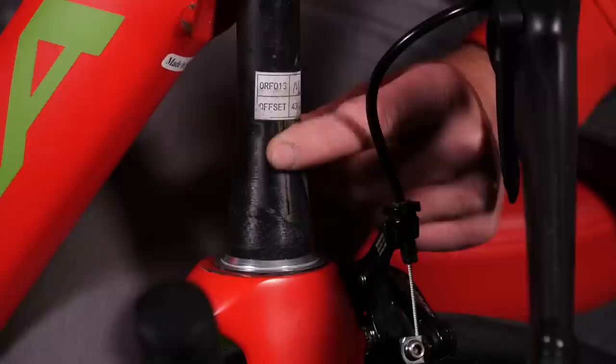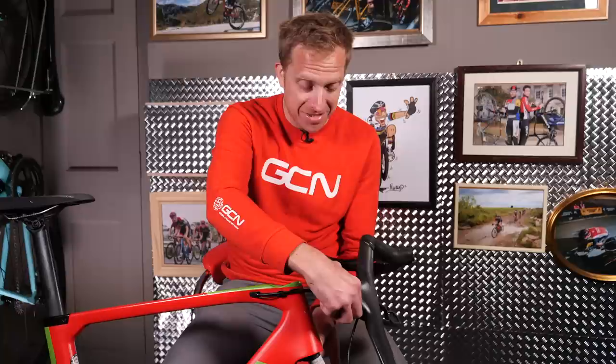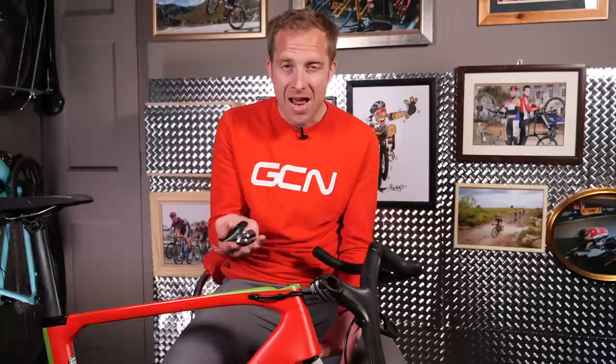The only downside, just like with the threaded style, is the fork crown race at the bottom on the fork crown. This is Chris Opie's bike — hope he doesn't mind I've borrowed it. In this case, we have a crown race which is interference fit and hit into place. Sometimes these can be split and simply pushed in, and in other instances you don't even have one. It's best to check with the manufacturer if you're unsure.